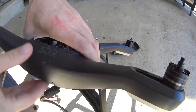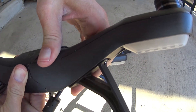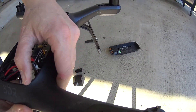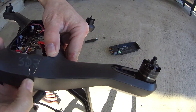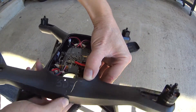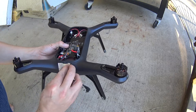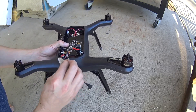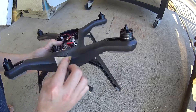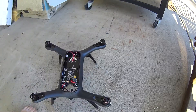You can see now that I'm able to squeeze everything together — very minimal gaps and it's fitting together quite nicely. I'm glad I broke that tab off. Those holes we drilled were to keep the plastic from cracking along that line. The next step is to prepare the body to be glued — just rough it up a little bit with some sandpaper. I'm using 80 grit, and I'll also get the inside because we're going to glue that portion too.